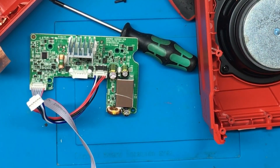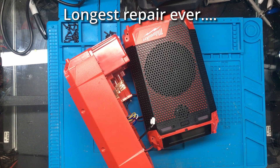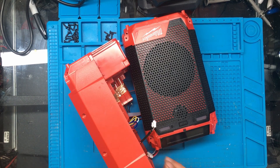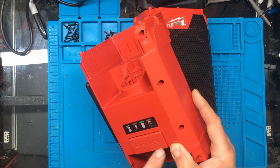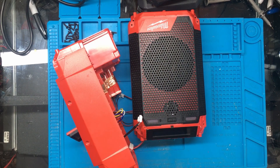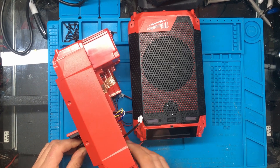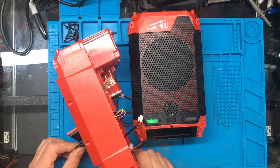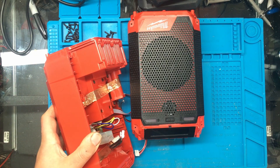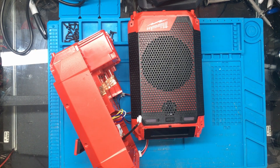It's been about three months since I started recording this video. I've been occasionally looking at this charging circuit when I've had time. On the back of the unit it says 12V DC and there's also a USB output. I put 12 volts into it but there seemed to be a fault. I've checked just about every component on this circuit board, traced it through, and still haven't gotten to the bottom of it. Today I thought I could really do with a schematic, so I wondered if there's anything on the FCC website - you sometimes find schematics there for radios and similar devices.